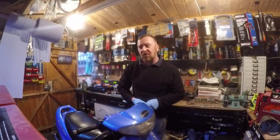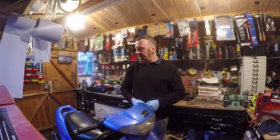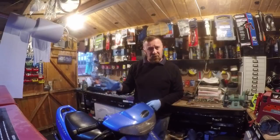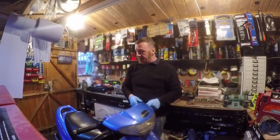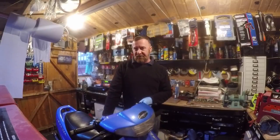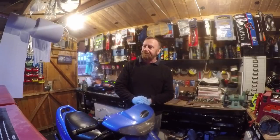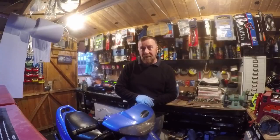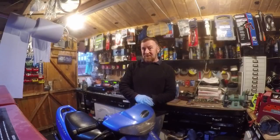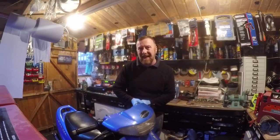I got this off the same guy I did the last video for — the XRT 125 LexMoto. And that was the crappy petrol — watch that video. So this started on the button, then it ran for a little while and died. Won't start again. Do you reckon he put the same crappy petrol in all these bikes? That's what I'm reckoning. So I'm going to suck out some of the petrol and see what mess we have in there.